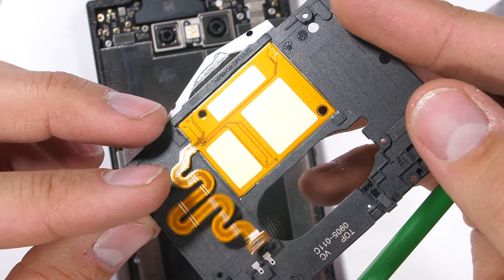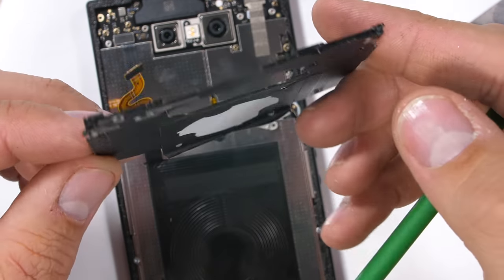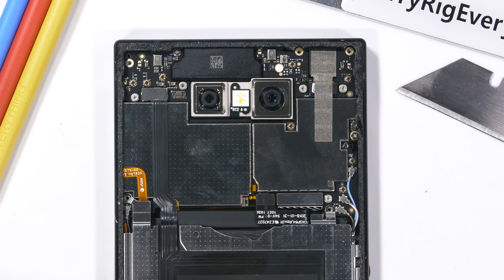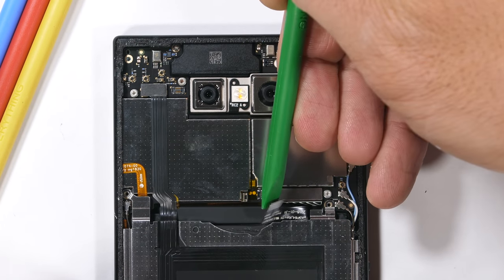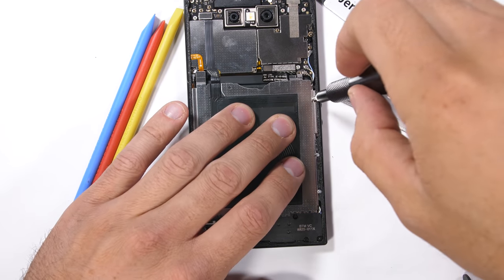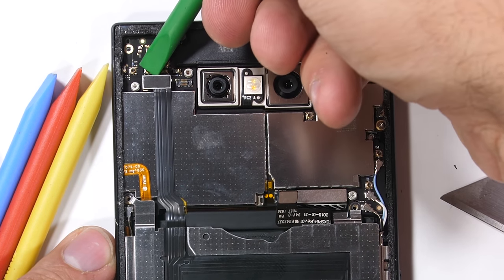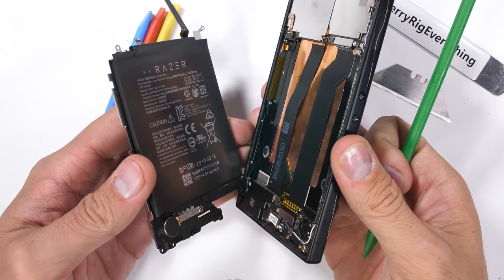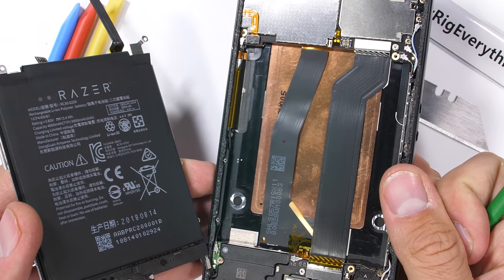Apple really dropped the ball by not making their Apple logo glow on the back of iPhones. I'll pull off the metal bracket over the battery and charging port plugs, then unclip the battery. The bottom half of the phone has another 10 screws, all different sizes. And then amazingly, the whole battery and wireless charging combo very easily unfolds out of the phone, exposing part of the massive copper vapor chamber.